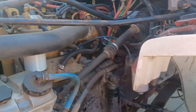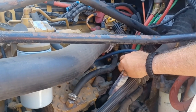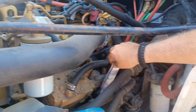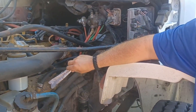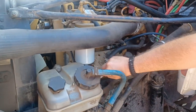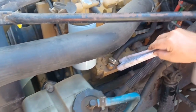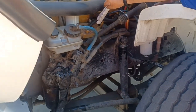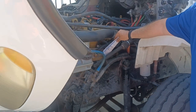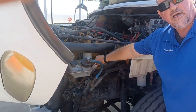On the back side of this air compressor is a power steering pump, way down in that hole. It is gear driven, driven off the back side of this air compressor, which is also gear driven. The air compressor is affixed to the engine block with bolts up front here, and it is not leaking. You see no signs of leaks around the hoses and no cracks in the housing. You can identify this as an air compressor because it has this big square head and fat round belly down there.